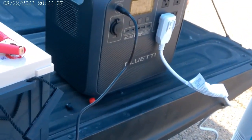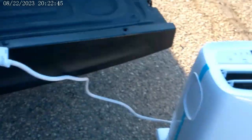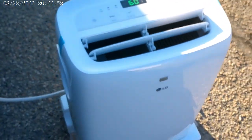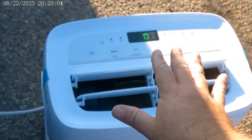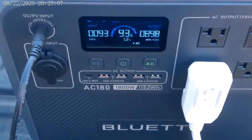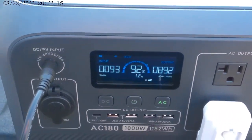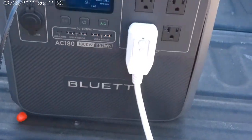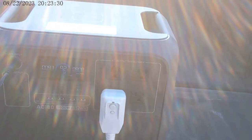Right now I'm testing a new system — the AC. What I'm trying to do is make sure I have working systems for when I arrive. I have this portable LG 7,000 BTU portable air conditioner, still in the base package. I'm just testing it right now, and as you can see it's working — it's hooked into the Bluetti. It's about 900 watts. It's drawing quite a bit. This is a 1,152 watt-hour battery, so it'll last for a little over an hour at this rate.